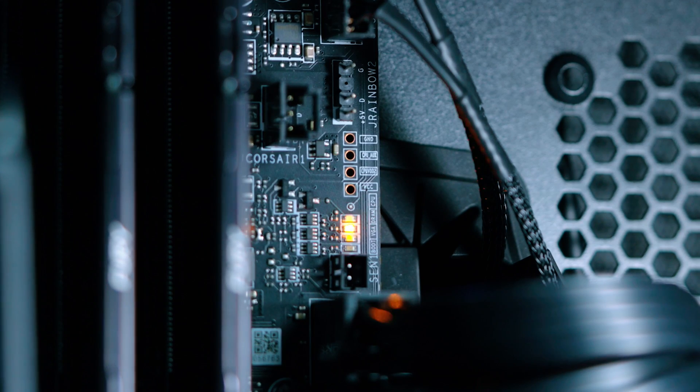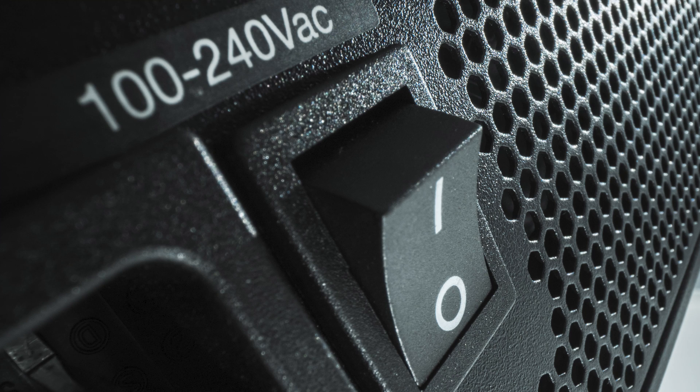Let's recap. If your computer doesn't boot, don't fear — check for lights and/or beep codes. Your motherboard will have a list of what the codes correspond to. If you don't have beep codes, check to see if your power supply fan kicks on. If it doesn't, check the outlet, the power cable, and the connection. If the fan kicks on but there's no power, check the 20-24 pin on the motherboard to make sure it's not loose. If you have random shutdowns, check to see if your power supply is not overloaded, but also check to see if your motherboard is completely away from the case.